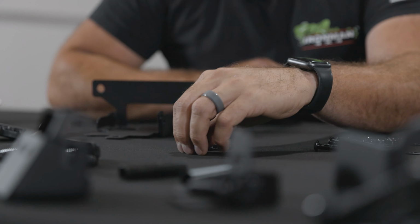All right, so we still have some disassembly we need to do. I'm gonna grab the grill. We'll flip it over. We're gonna pull the front camera out so that we can relocate it into the Ironman 4x4 Raid front bumper. I've got a little 1/4" T27 Torx bit. I'm gonna pull these guys out, remove this bracket. We'll work these clips and we'll pull our fiber optic line and our sprayer line all out.